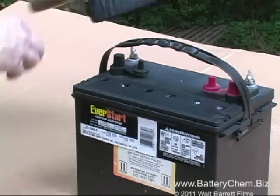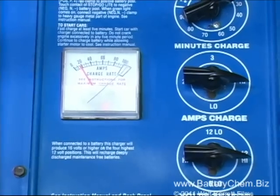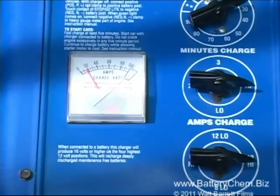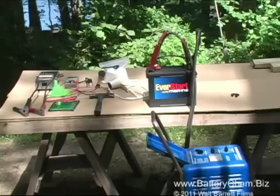Now we just clean the battery off and it is ready for the charger. The red cable is the positive cable and the black cable is the negative cable, and they must match the positive and negative symbols on the top of the battery — red is always positive and black is always negative. We will charge at the maximum voltage and maximum amperage until all the cells are bubbling, which indicates they will take a charge. Then we will switch to a long slow charge at no more than 5 amps and continually test the battery until it reads properly. This is an overview of all the equipment that we use to do this battery.